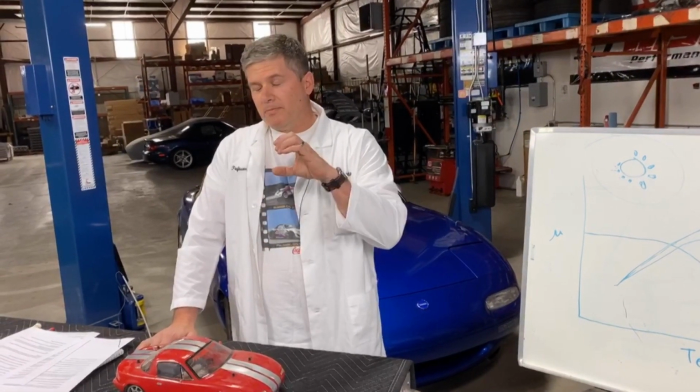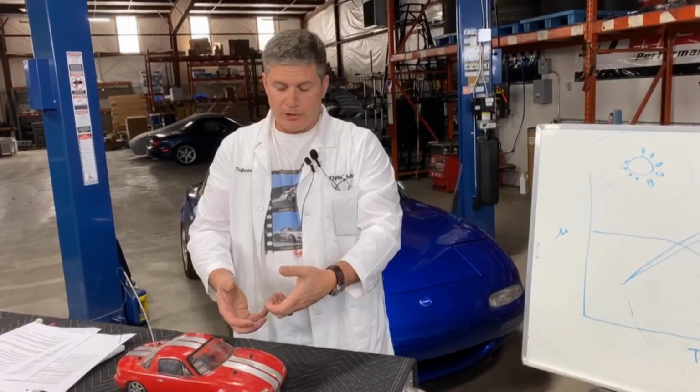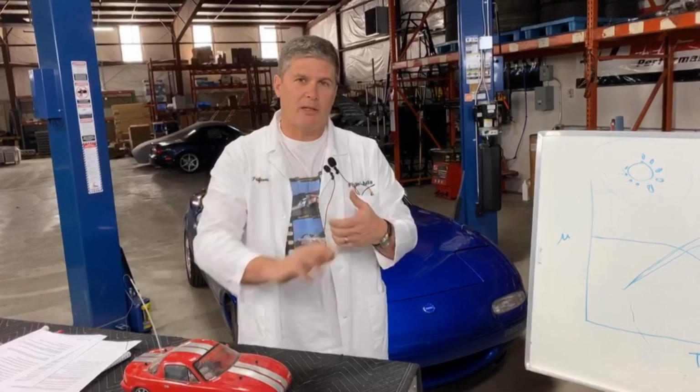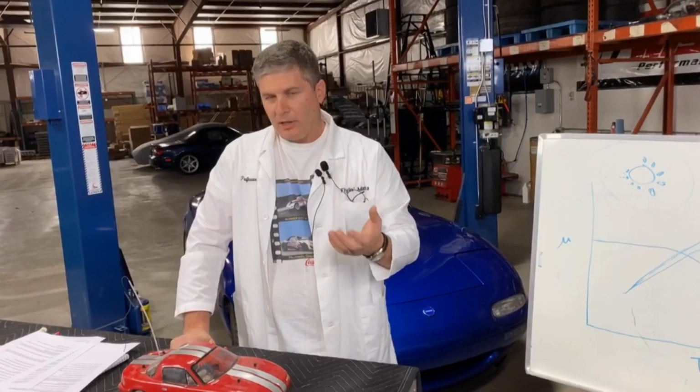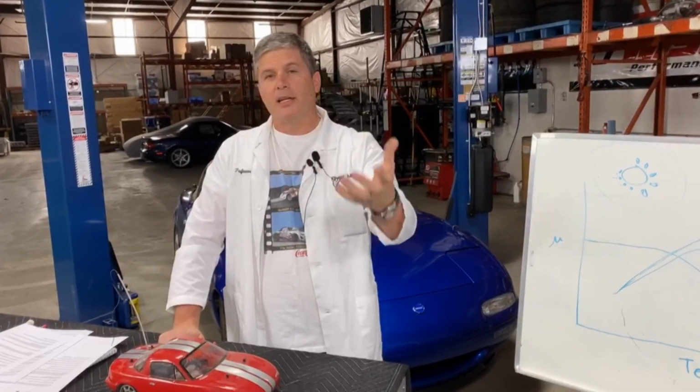If you put a bigger piston in the calipers, you'll get more brake torque there, but you're going to have to move more fluid to do it, so you'll end up with a longer pedal. You end up with a soft, squishy pedal. Street drivers often don't mind a soft, squishy pedal if it means that they get lots and lots of bite, so they'll often make that trade-off.